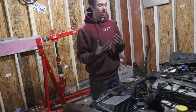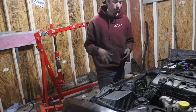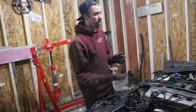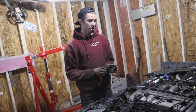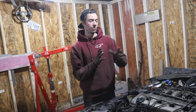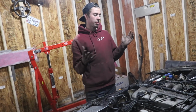From my experience, I really suggest pulling the engine, because if I was gonna keep this car forever, I would have done all types of gaskets and replaced things that are cheap but are just gonna make it more reliable and not all oily like this engine. It's just a better game plan. I've done transes in these cars, and KA transes are tough to get in there compared to SR transes. I don't know why. I think the bell housing's just bigger.